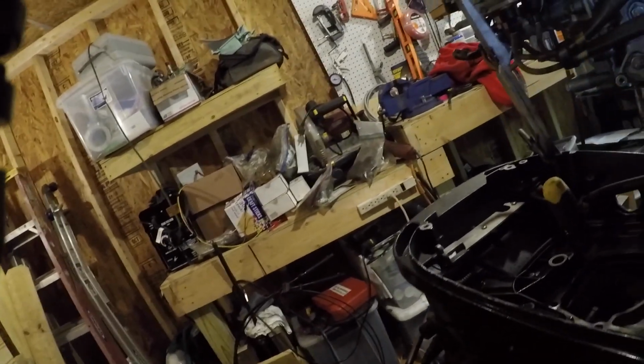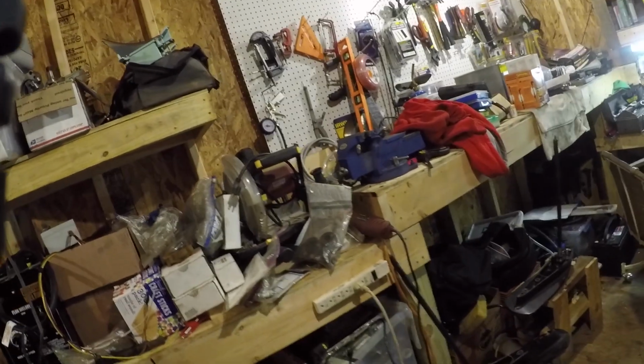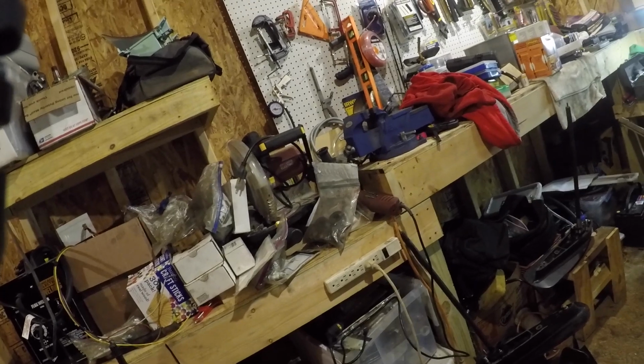I am going to put my water tube back on because once it goes down there, it's hard to get it back on. And then I'm going to just use my lid, center this up, and then I'll just drop it in there. I already got the gasket on that one, so it's kind of easy, be easy with it, gentle. Get it up on the head. Once I get it in place, then I'll have to put this bracket that goes to the shift shaft. And the shift shaft too, when you're putting it in there, it'll help it center a little bit.